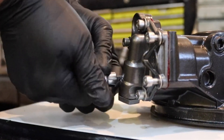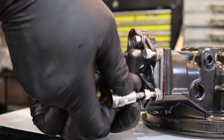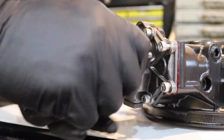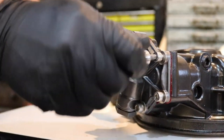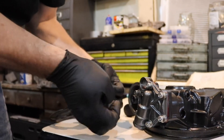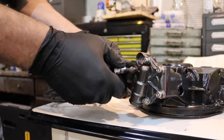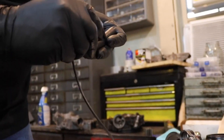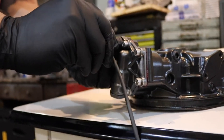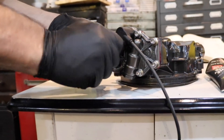I just remembered one small feature on this motor I have to do differently — this is going to be a fuel-injected motor. With a fuel-injected motor, it's going to need a crank position sensor. It needs one of these — a crank position sensor. It's going to read the crank for the fuel-injected motor. This one goes right there. Slide it in place, then bolt it down.